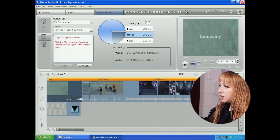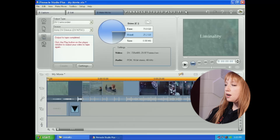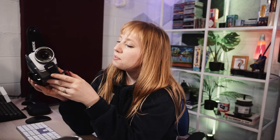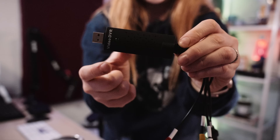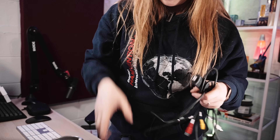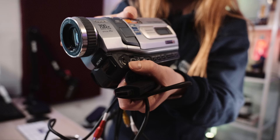Now we can import this footage back into the computer — and here I am about to discover that I have a new problem. For some reason it's not recognizing it. I'm pretty sure this project is cursed. When I was trying to take the footage I had put on the tape successfully back onto the computer, it kept not working. It turns out that the actual FireWire port on my camcorder is broken. So FireWire is off the table after all of that work. But that's okay because I got a cheap USB to S-video converter and plugged the S-video cable into the S-video out of my camcorder, and I captured the footage that way.